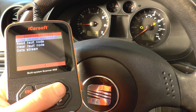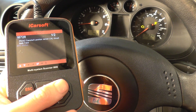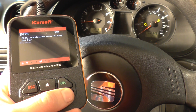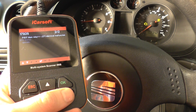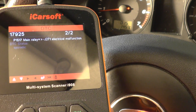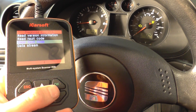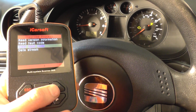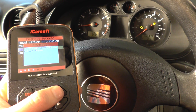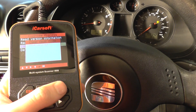You can also visit www.diagnostic-world.com. So reading the fault codes — the fault code we're getting is 16726, camshaft position sensor, and then 17925, relating to main relay electrical malfunction. We previously knew about these faults and they have been fixed, so we're going to clear the fault codes. Keep one eye on the engine warning light — and there we go, the engine warning light has disappeared from the dash.